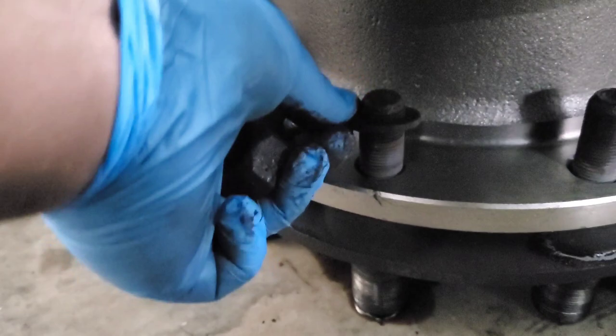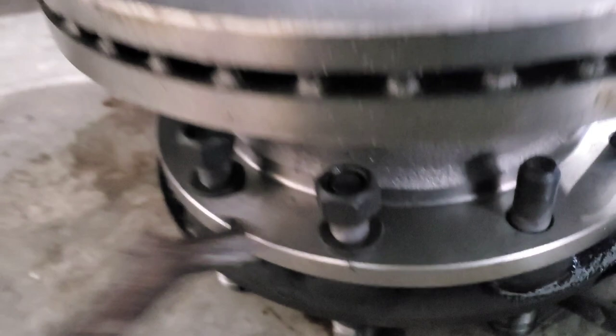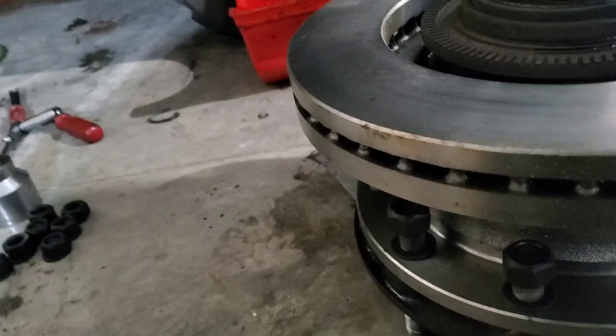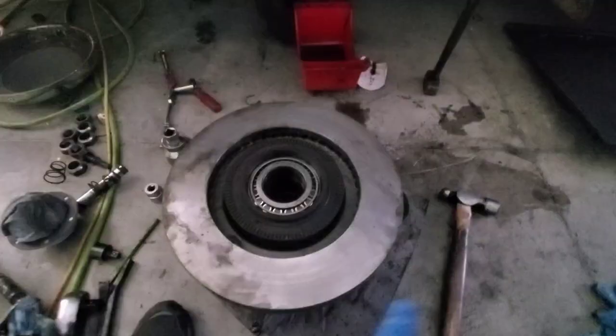Now that all the bolts are out, we've got the rotor going on there — just started to get some bolts back in it. Make sure you put your washer down first, and these are flange nuts — they're only going to run down until they get right up to the top of the nut, just like these are — and then from there on you're going to be stuck using a wrench. We'll get some tightened down across from each other and then get this thing rolled up on its side again where it's going to be easier to work on.